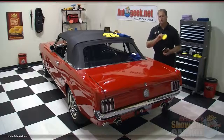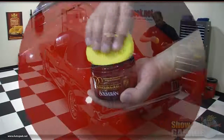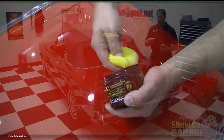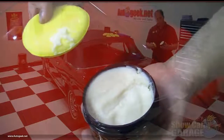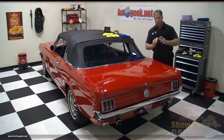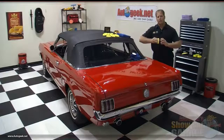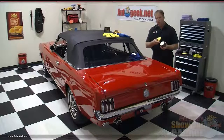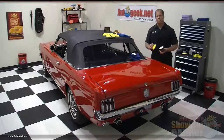Now this pad is ready to start applying wax to the paint, but let me show you a mistake a lot of people make. Instead of spinning, they'll take their pad and scoop out a chunk of wax — and then how are you going to spread that out? So use the technique I just showed you: place your pad right against the wax, spin the jar and the pad, and this little bit of friction will melt the wax just enough to seep into the pad. Now we're ready to start applying wax to the car.